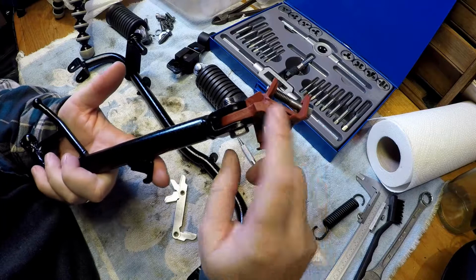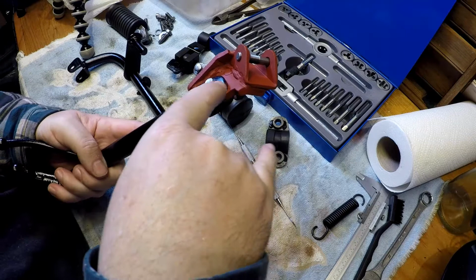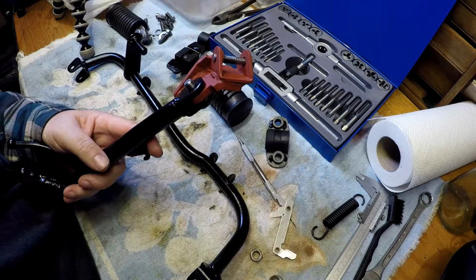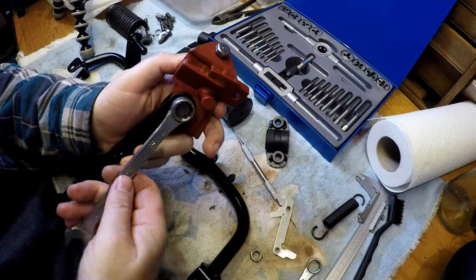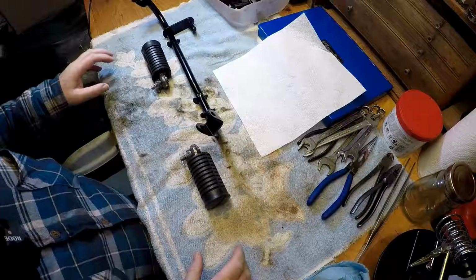But as a note, this bolt going through here, it's an awkward one. I've just tried to re-tap it because the thread's a bit damaged, and it's an M10, but it's at 1.25 pitch, not 1.5, which is your standard M10 pitch rate. So I might start looking at investing in some taps and dies at those various alternative pitches. So I'm going to carry on getting stuff set up ready, and then we'll look at doing the full assembly, get the grease out and that kind of stuff. So yeah. Right, let's put the foot pegs together.